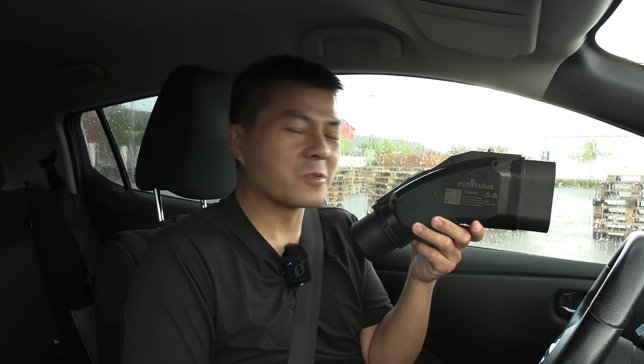If you guys are up for it, I should try to borrow a LEAF 62 kilowatt hour and then test — that's a big battery — maybe do a 1,000-kilometer challenge with the adapter charging at 200 amp, see how fast it rapid-gates versus throttling it to only 125 amp around 40–47 kilowatt, and see if that yields a better 1,000-kilometer time. I'm not sure if I have time for that challenge though — I might be old before I finish.